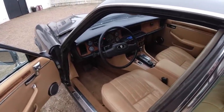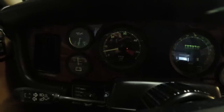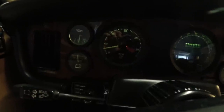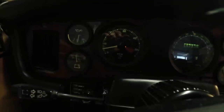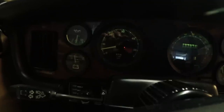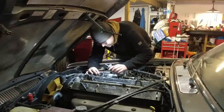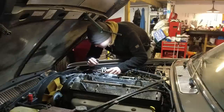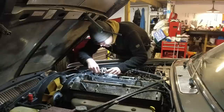Have a look at the idling in gear, especially if it gives some throttle — like if I want to go up a hill — it goes down and it basically almost wants to die. So we do have a major issue. I've got the coil disconnected here. I'm just going to connect up this coil, which has the correct ohmmage for this ignition system. It should work, and it is a known good coil, so that's also a bonus.